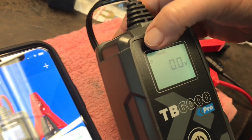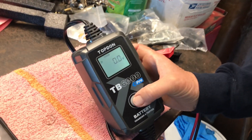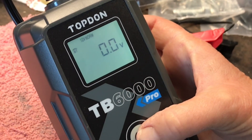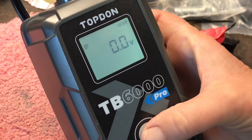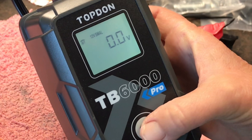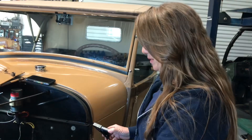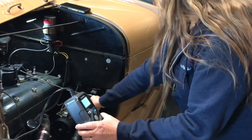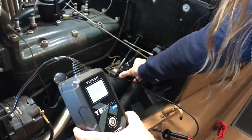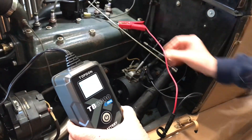The Bluetooth button is done flashing and it's stable. One fantastic thing about this charger and tester is it has six modes. Right now it is showing 12-volt norm — it's got that one, that one, that one, that one, and the lovely 6-volt that I'll be using. We're going to go ahead and hook it up on the 6-volt norm setting. I'll put the black on this one and the red on the grounded part right there.